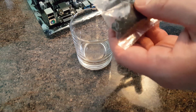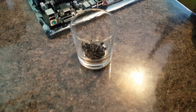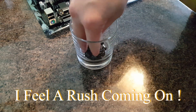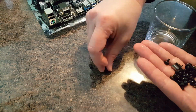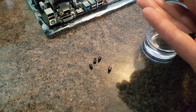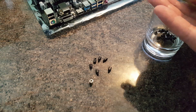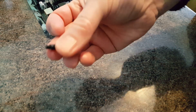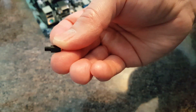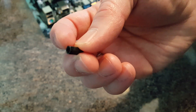What I suggest is get yourself a nice little cup or glass and keep all of these standoffs safe. What we've got to do is pick out all of them. This end screws into the case itself, the motherboard goes on top, then the screw secures the motherboard to it, and the gap protects all electricity from touching the case.